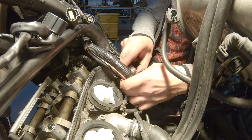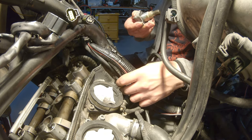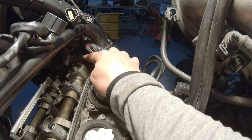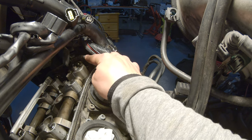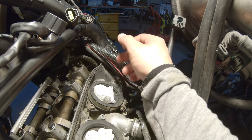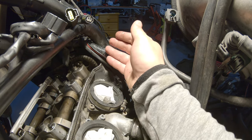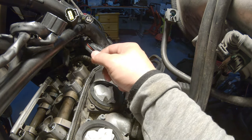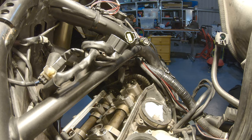And this is out. The gasket came with it. Obviously, the intake sprocket skipped, because there is a little bit of pressure applied to these lobes. So when I released the chain tensioner, it skipped. We are going to deal with that later when we have to put it back together. I was not hoping to keep all of that aligned. So we are ready to remove the camshafts.